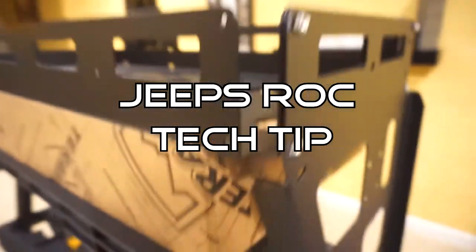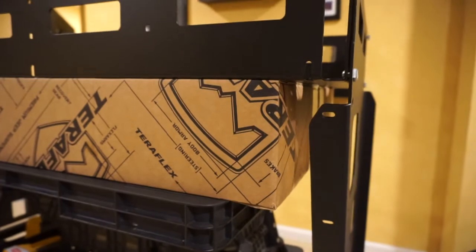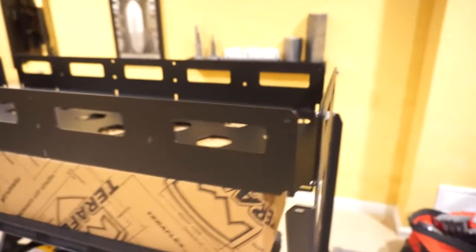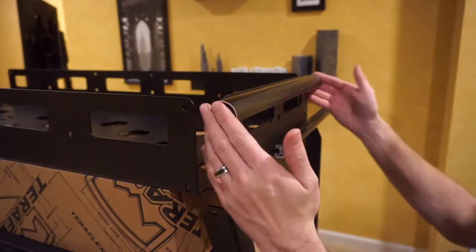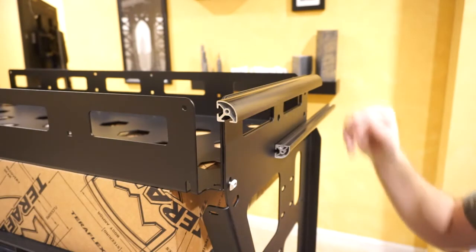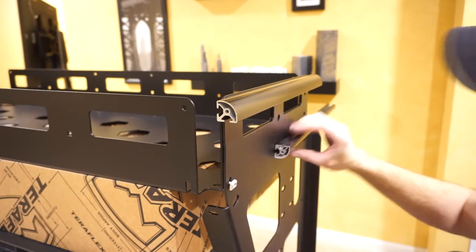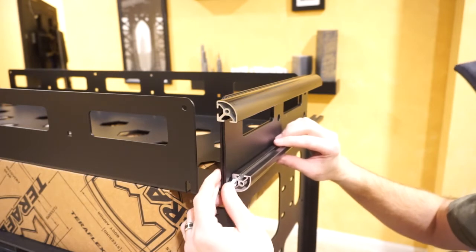I left the original box here and placed it on the bottom of the table — it's always best to work smarter and not harder. Installing this on my own, it's all nice and level so I can easily do it without help. The next step is to add the aluminum rails — everything else on the build is steel except for these rails on the top and bottom. They work like T-nuts and allow you to slide only one way through a channel. The instructions say to leave these very loose, and you definitely need to, otherwise you have to back them out to slide the rail through.